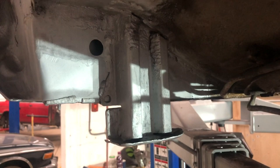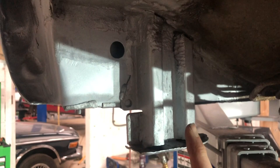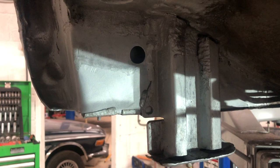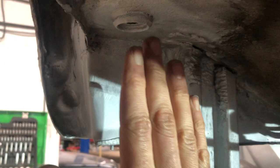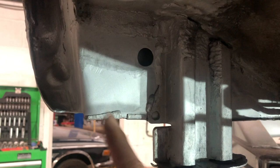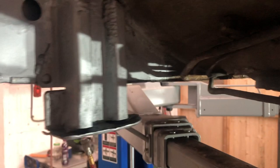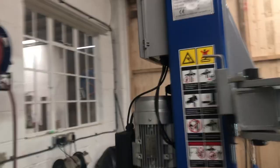You don't tend to see these on cars other than M535i's — this here is all factory welding, but this section, the inner triangle, we've had to repair on this car. The inner triangle is a pretty common area. The axle carrier normally sits almost up against this and you can see — get under it and look up — it's a really bad mud trap and they rot through. You can see where we've had to replace this section and the sill end. Almost all of these cars now will have had some welding there, but you certainly want to look in that area and make sure it's clean.